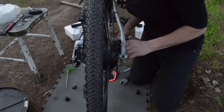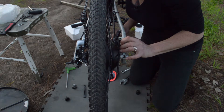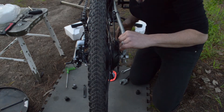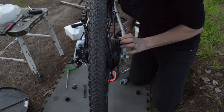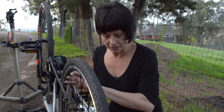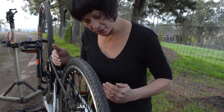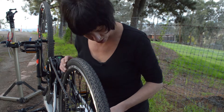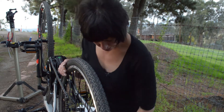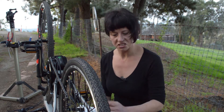Usually it's at the end of the job that you actually do the exact fine tuning of where the brake calipers sit, but you can do it pretty well by eye while doing them up here. Just make sure the pads aren't touching on either side of the disc. I can hear a slight bit of rubbing — when we do the bolts up the position of everything changes slightly with pressure. I can see the disc is rubbing just slightly on the inside but we can correct that, it's no big deal. The only final thing is putting the nice little covers on over the nuts — and that's essentially job done.